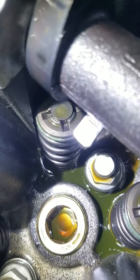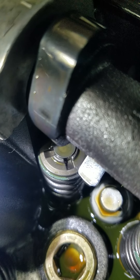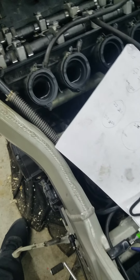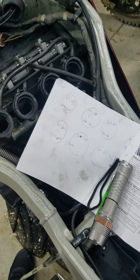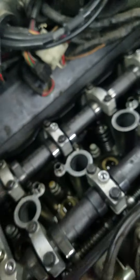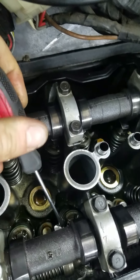There's your flashlight, and there's your valve shim exposed. I was using a magnet to get them out. Then with your feeler gauge, spring the rocker arm back down — just push it down or up, whichever way — and it'll spring back into position.